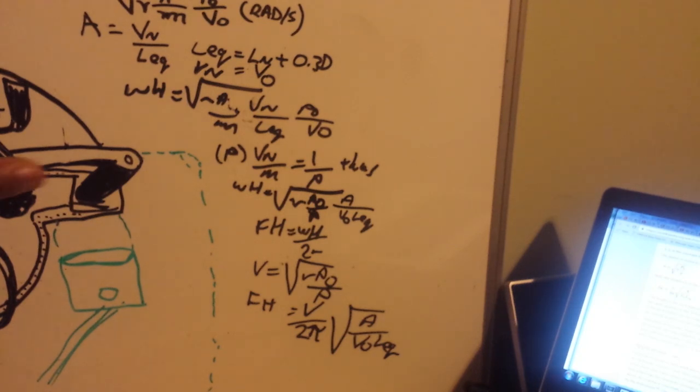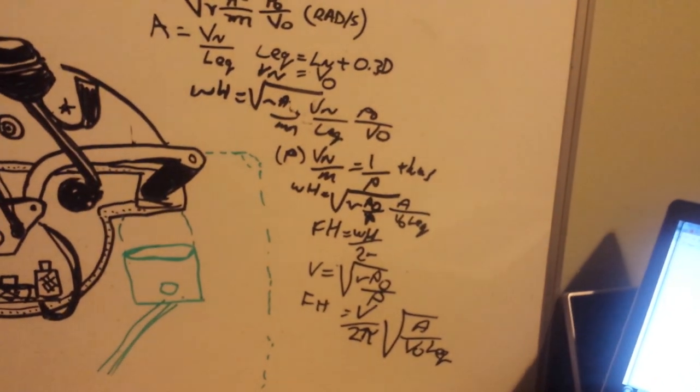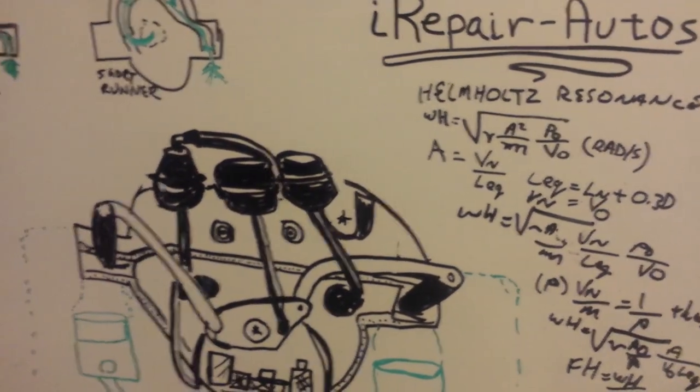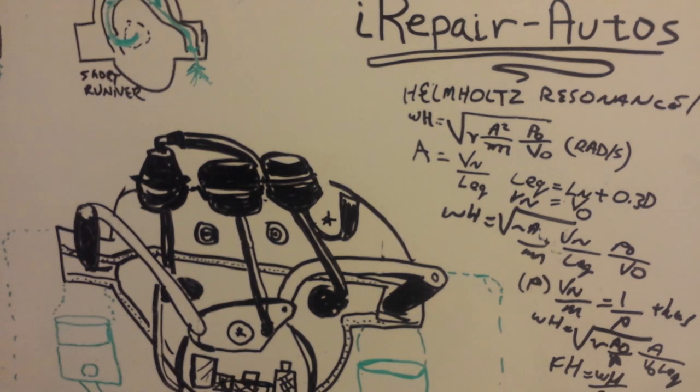So all of this is to just describe how they come up with the variation in the variable air intake. That hole in the back of the air intake manifold is monitored as far as the air coming through, with the mass airflow sensor that comes before that. It checks the pressure of the air, the temperature of the air, the quality of the air as well. It's able to detect if it's running in an enriched environment. Enriched environment meaning if there is gasoline.